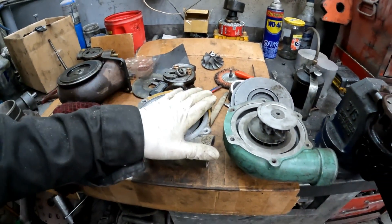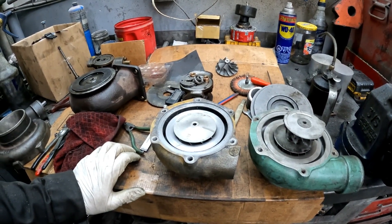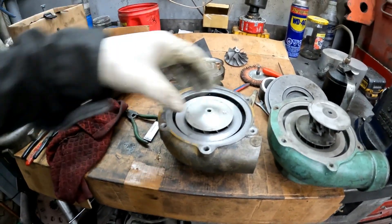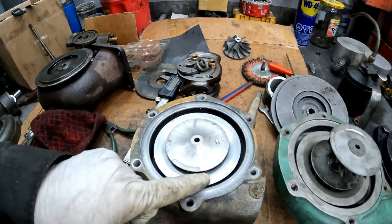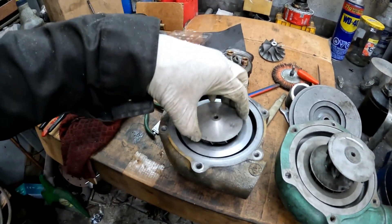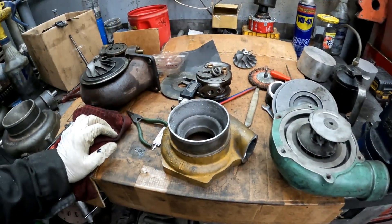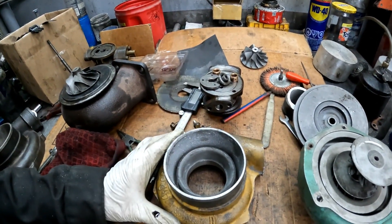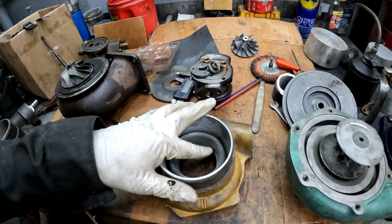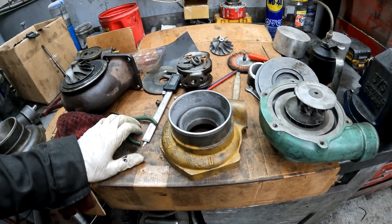I'm using this old housing and making sure I can actually turn it on my lathe precisely and get this radius correct. I've got it just about perfect, so now I'm going to put this back on the lathe and work on this space here. What I'm going to do is what's called a T51R mod — essentially it gets rid of this piece here, puts a surge protection in, and makes the turbo whistle more.